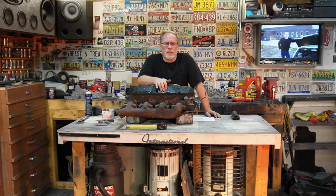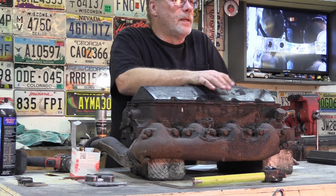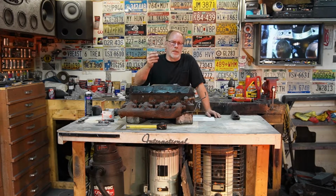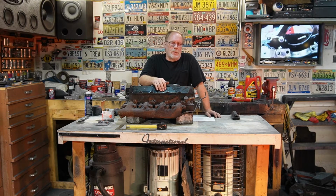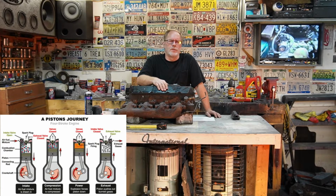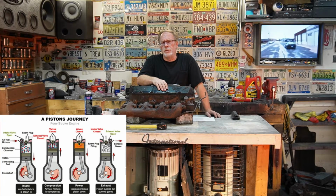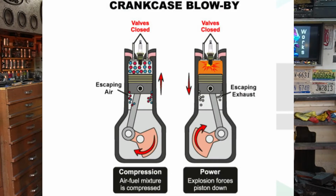By doing this mod right here, even if you have a regular turbo or you have one that's pushing out 30, 40 PSI, adding the second CCV on the passenger side is just going to let the engine relax. You're not going to be worried about blowing out seals, blowing out turbos prematurely. And once again, we don't want that crud back into the engine oil. Diesel engine oil is a very crud-filled type of oil towards the end of the oil change. And if we can prevent that from getting back into the engine, back into the cylinders, we're just going to be so much better.